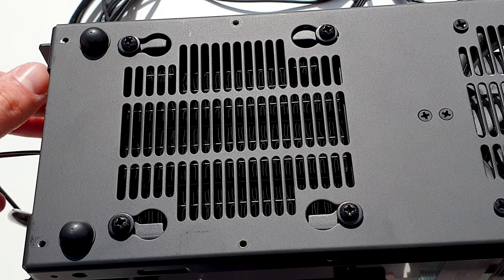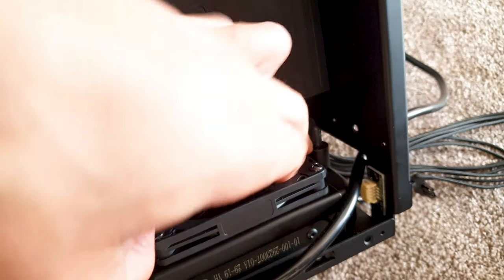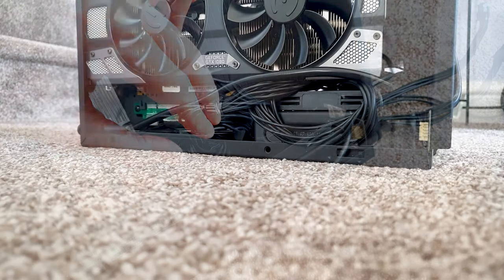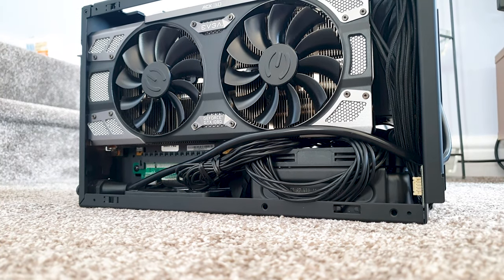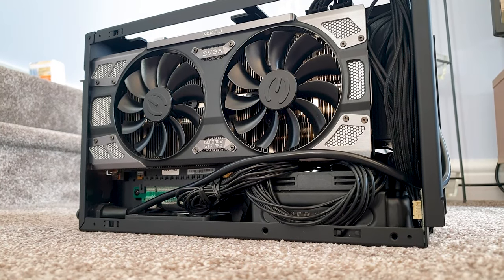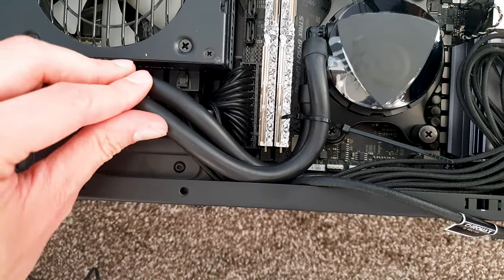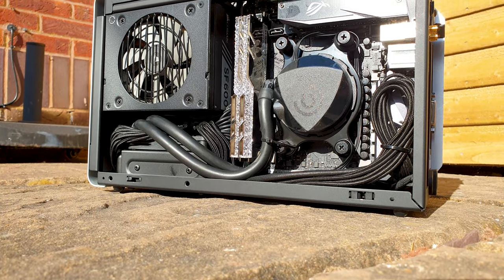Also, I must point out that I went back to my original cables and reused only the 24-pin one since it's easier to manipulate than the premium kit, just because it's overall thinner. Then I relocated the whole length of it on the GPU side like so. This will help a lot since we need the extra space in the front for those AIO tubes to clear. Plus on the GPU side I would recommend that you remove that plastic transparent film since it will interfere with the wires around the GPU. Finally, this is the best variant I can do with this combination of wires and specs.